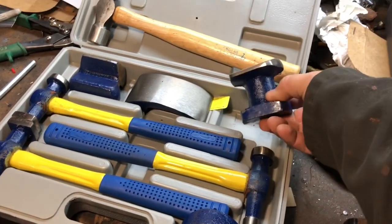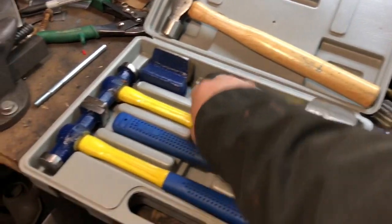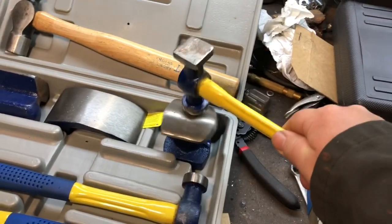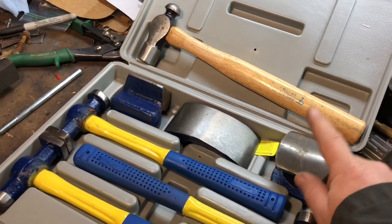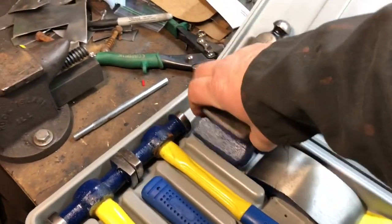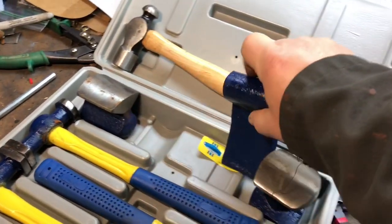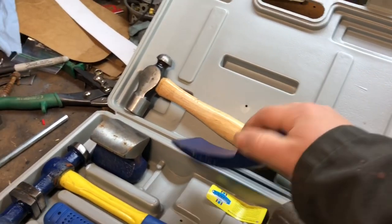Basically you have these different dollies, you hold one in, and you use a hammer. They're usually just flat hammers, or with a little bow in them like that. Then you hit the two pieces of metal together, and it becomes basically a portable hard surface to smack onto the flattened sheet metal. This one has a different shape to it, and this one has a little different shape wherever you're working. See, it has all different shapes, so if you need to get in different areas.